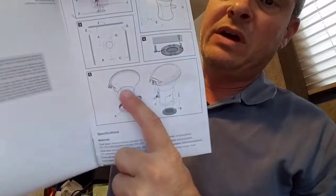The way I remedied this: after taking the four screws apart and separating the two halves, I took the gasket, made sure it was clean and dry, then used a sealant — I'll show you what I used, though I think I used the last of the tube. I'd recommend clear silicone because it stays flexible. Take the rubber gasket out, clean and dry that whole area, work the RTV silicone sealant into the gasket really well. Before laying it on the bowl base, put a bead of silicone down, lay the gasket on, then put another bead on the other side. Make sure the top edge is clean, then seat the two halves together.